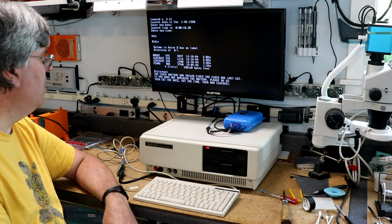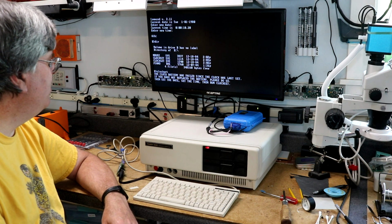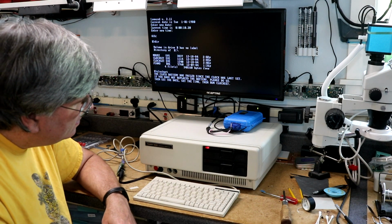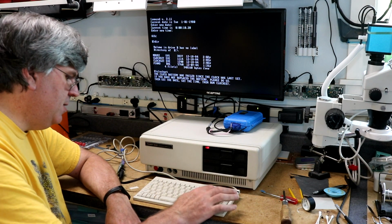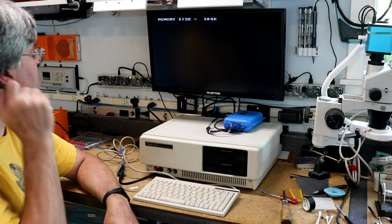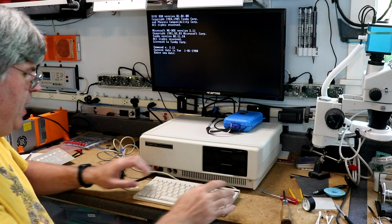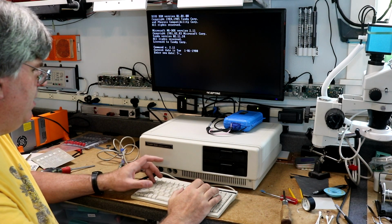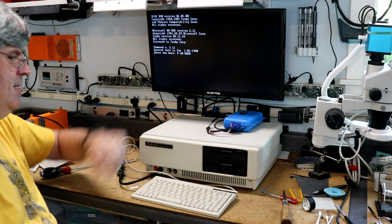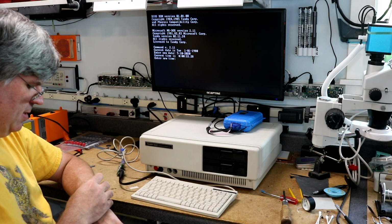Clock battery has failed since the clock was last set. Well, that's obvious because we did replace the battery. If you've not replaced the battery, please do so. Okay, we just did that, then set the date and time, run clock set. And I guess it's just going to hang until we reboot. So let's reboot. Okay, today's date would be May 10th. 5, 10, 2020. Well now, what's going to happen with that? I think it's going to take 2020. It looks like it did.